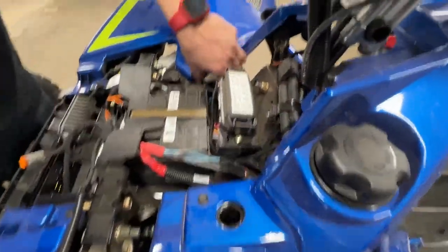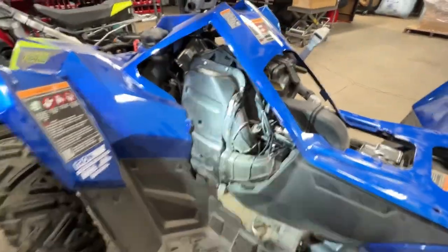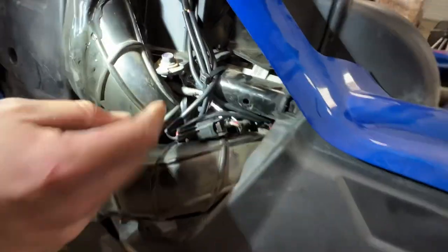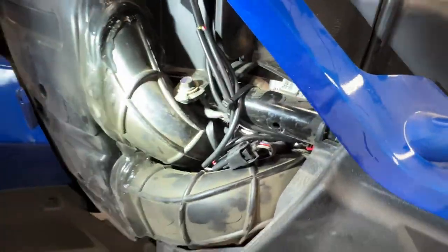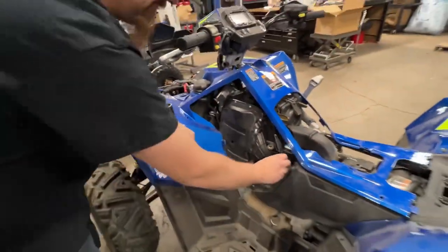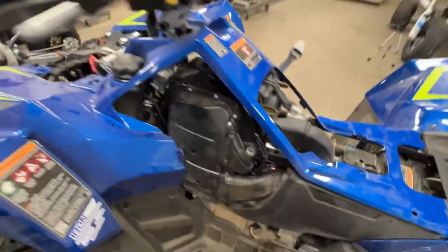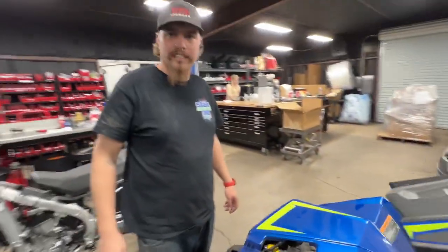Let's talk about the optimizer. This little guy is mounted right here, tied to the battery, then the wiring goes all the way back. You've got two injectors on here — there's one tucked way down there and one tucked way down over there, so just stick your fingers in there and hope for the best, or use a pair of needle-nose pliers. It's basically a piggyback system — you're going to piggyback off the new wiring to the injector, and you'll be able to control your fuel supply with this little tuner. Always get one of those when you get an exhaust.